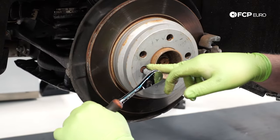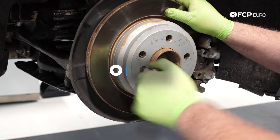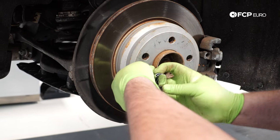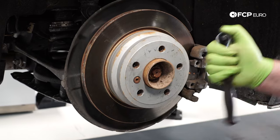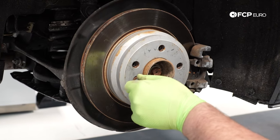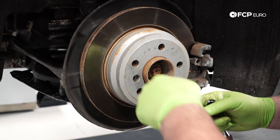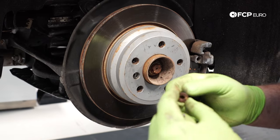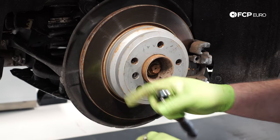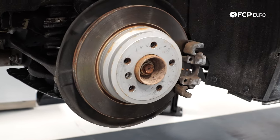Next up we're going to remove our brake rotor set screw — it's a 6mm Allen. Hopefully it's easier to remove. If not, and you actually strip the hex, you might have to either drill the head off the screw or you could sometimes knock it off with a chisel — if you just kind of catch the corner you should be able to spin it. These aren't torqued that tight, or they shouldn't be. So just in case this gets stuck, you can still remove them and get the rotor off. Chisel or drill — those are your options.